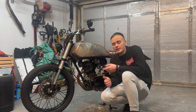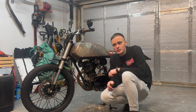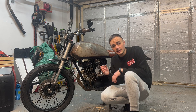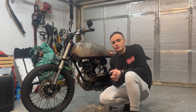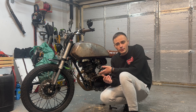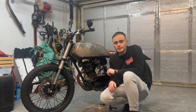What leads me to believe it's the contact breaker that's faulty is that when I first got this bike it was a non-runner, and the component I had to replace to get it running was the ignition coil — and part of that was the condenser. The condenser's job is to prevent arcing across the points, and if that goes faulty you get arcing across the points which causes them to go dirty and pitted. I think that's what's happened here, so we'll take it off and replace the contact breaker. A replacement was eight pounds, so I'm putting on a brand new one, set the points gap and ignition timing, and hopefully it should run as sweet as a nut.